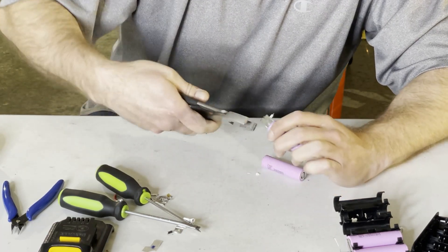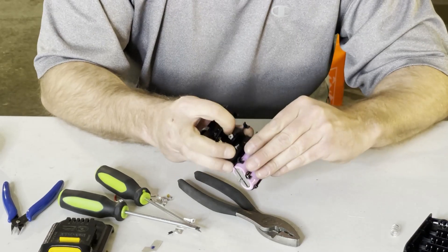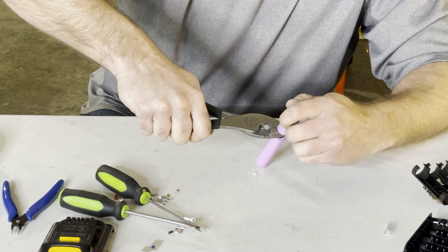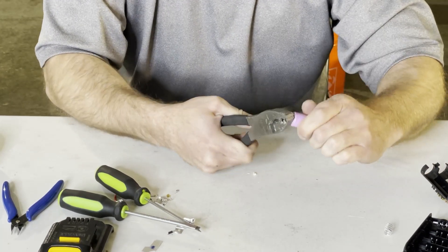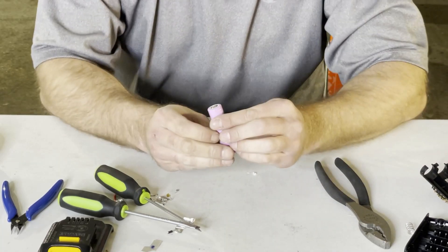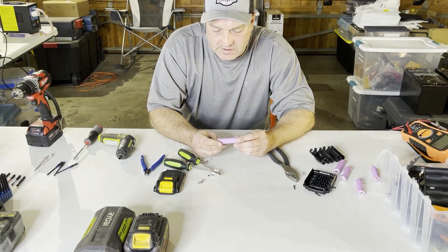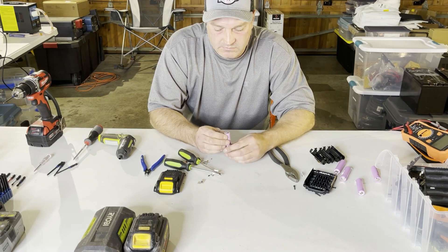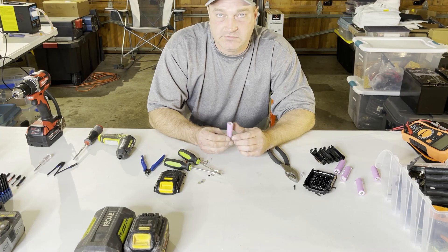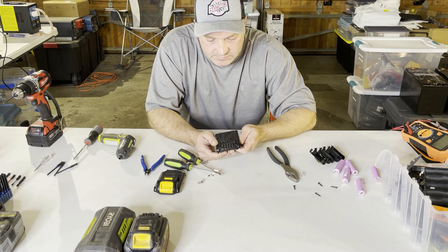The rest of this I'm just going to pull the pack out and get these cells out. If you get real close with a pair of pliers and rock it a little bit, it helps with not pulling on that negative cell. In another video I'll show you how to grade and charge these cells to get them up to spec. These are Samsung SDI 13Bs — very common in power tools because they have a good high discharge rate, so they can handle the heat and quick discharge of larger electric motors in power tools. That is the teardown. This particular model is a DCB 207.